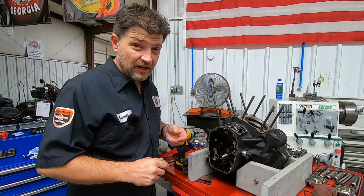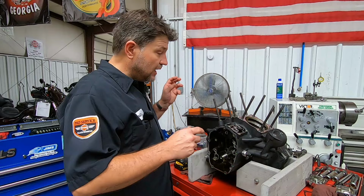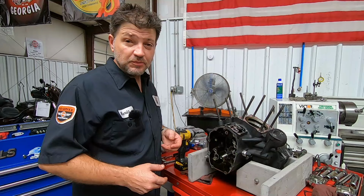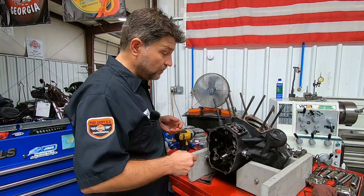And also, he had already upgraded his cam plate and oil pump. Doesn't look like he did that too long ago. However, the noise, yes, we've got a bad rod bearing. 80,000 miles, that's pretty impressive, really. It's a bad rod bearing. After 80,000 miles, not too bad, but that would explain the noise. It would also explain the discoloration on the rod. It would explain a little excessive heat back here and turning everything gold. That extra heat, bad bearing. So there we go. All right, guys.